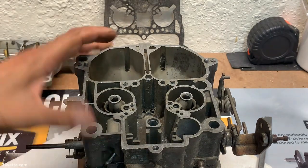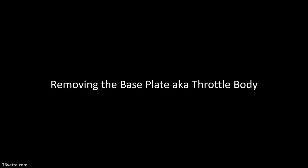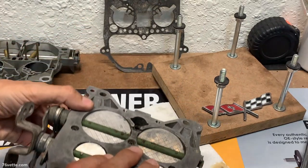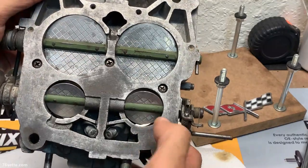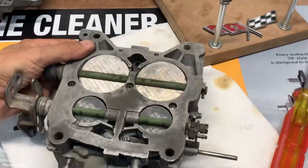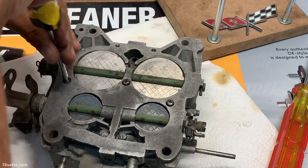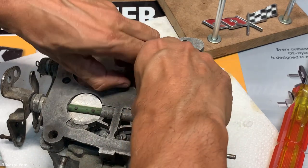The big jets look good from here. Next I'm going to turn it upside down and remove the base plate. This one is the older style, so it has three Phillips head screws that secure the base plate to the body. Wow — these were barely on there, they're just falling out. I'm not complaining. We're going to tighten them a little better when we put it back together.